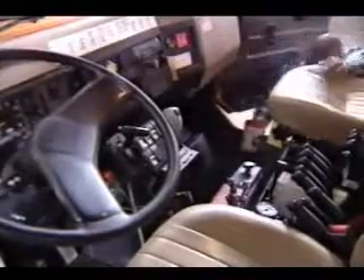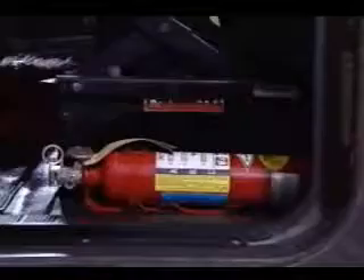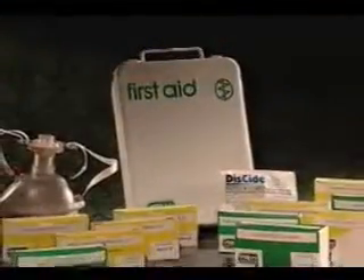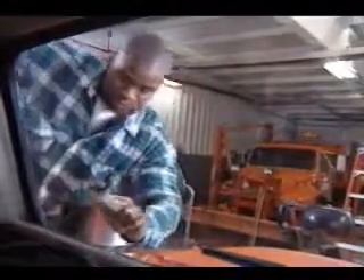Check one last time inside the truck cab. Make sure the cab is clean with no loose items like pop cans, bottles, or log chains. Make sure you have a fire extinguisher that is properly mounted and fully charged, an ice scraper, a whisk broom or snow brush for cleaning snow off your lights, and a flashlight. Your checklist should also include a first aid kit — check the contents and replace any missing or damaged items. Make sure a CPR mask is with or near your first aid kit, along with the emergency reflector kit. Climb back into the cab and try the safety belts, making sure the lock works. Check the two-way radio and make certain the display or power light comes on. Check the dash lights and all gauges to make certain they are working.